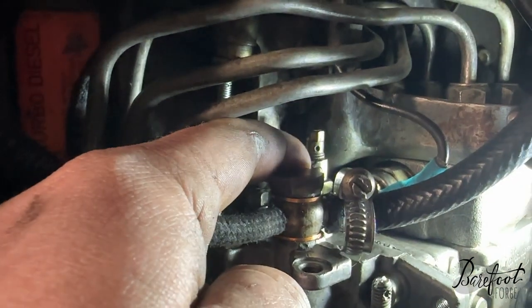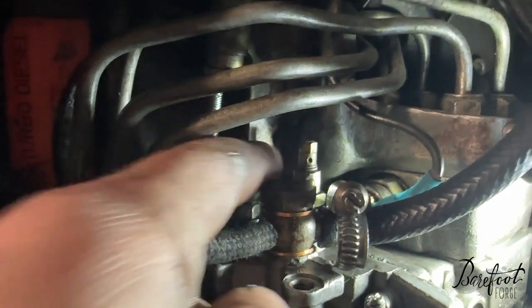Drove it - drove good, drove real good. But there's not a lot of power just off idle - there's a hesitation. We need to give it more with the enrichment screw, because this pump was made out of two different pumps since I broke my original pump in half, and the other pump might not be the right pump. So the screw isn't right relative to that. I was told to break the collar off so I can screw it in further to give it more fuel.